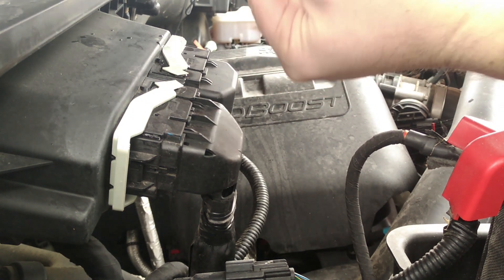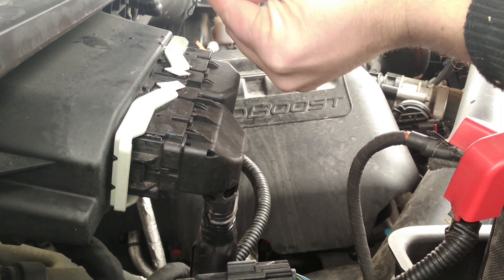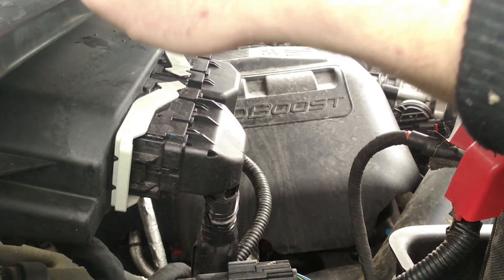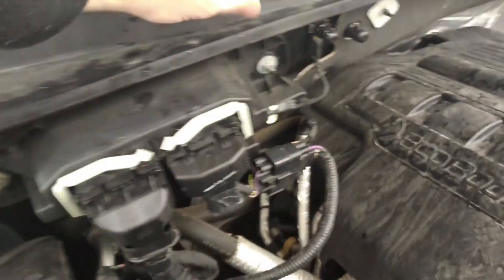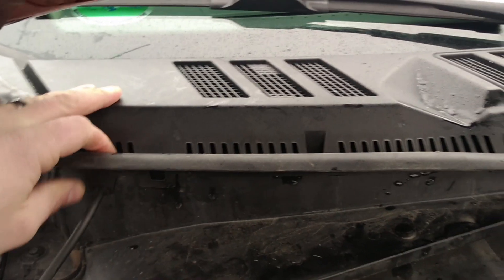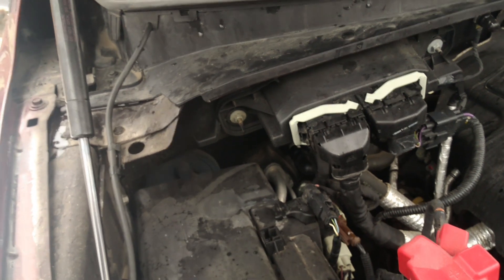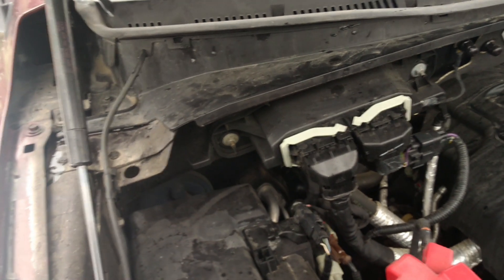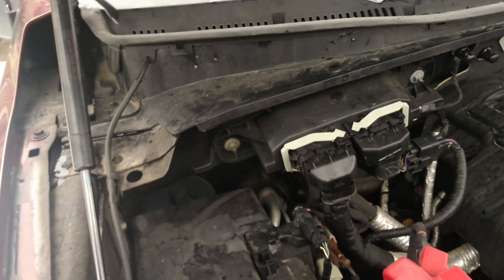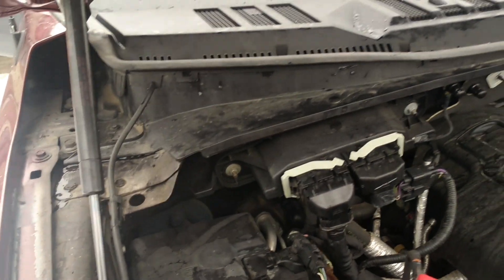You can still see the directional arrow — put it back in the same way you pulled it out. Push down the clips, lock back in place, and you'll be fine. Basically what that check valve does is give you quicker response when you pull your windshield washer fluid lever. Since drilling it out I've tested it and had no problems with freezing up. Response time may be slightly slower but it's barely noticeable, and you should be good to go.